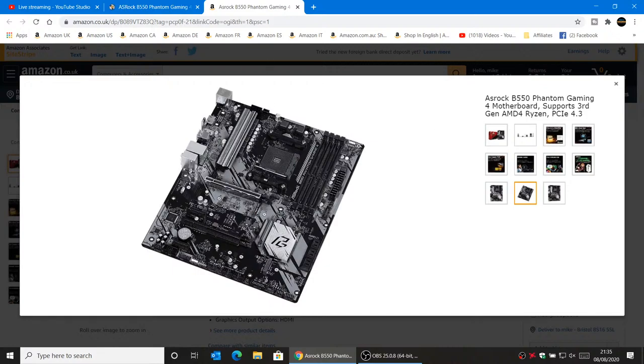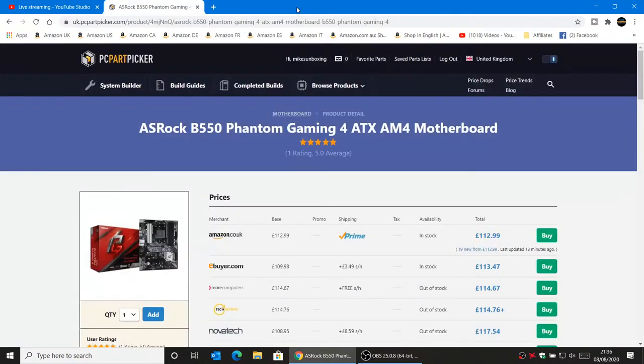And actually, what I quite like is the fact that it's a full width board. So you've got the 9 mounting ports there. 1, 2, 3, 4, 5, 6, 7, 8, 9. There's also a 10th one there if you want to. So you can make sure the board is nice and secure wherever you put it. Quite a few boards recently have only got this kind of half section here missing. So the board tends to flap around when you're trying to plug in any of the power connectors and all that kind of stuff, which is a little bit worrying if you short something out against a motherboard. Anyway, I quite like that. It's pretty decent. So that is the board.